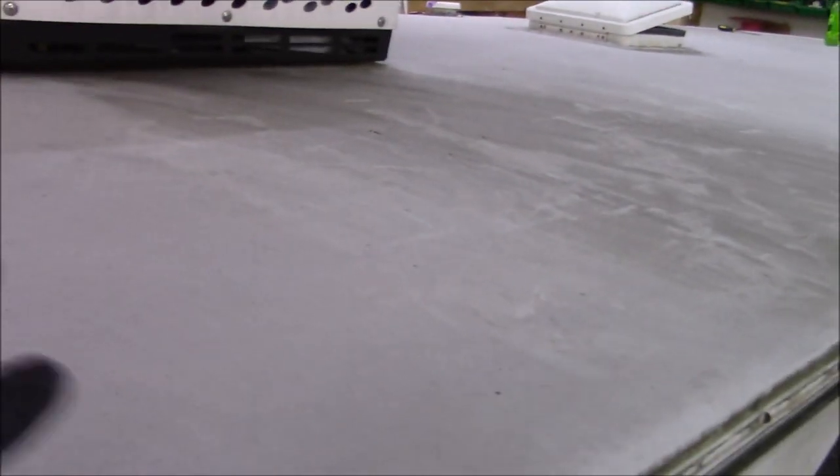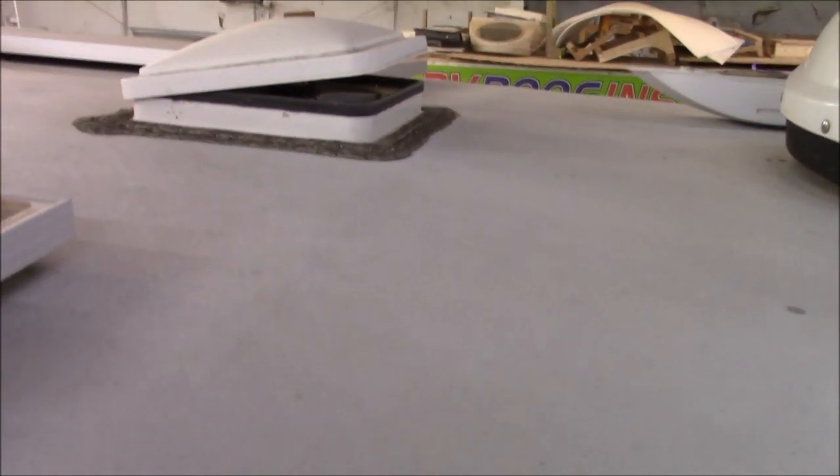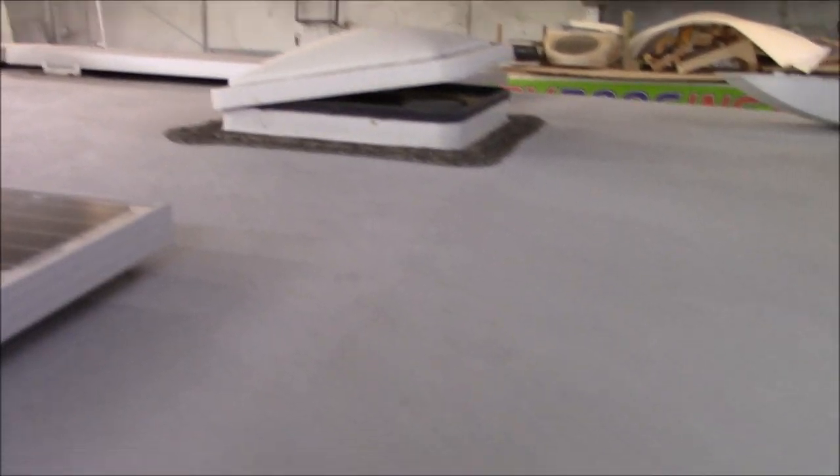Every project that I've seen that has rubber on it has never made it past the warranty, okay? So you can get pretty good rubber on here, but where it usually fails is all your transitions, just like these do. Because they rely on pressure-sensitive tapes and things to try to make them watertight. And also lap sealant. That's the process. That's why it doesn't work.